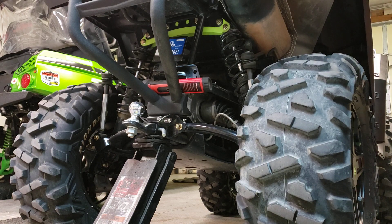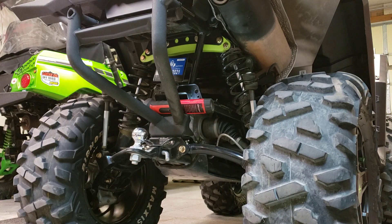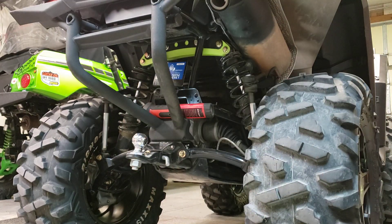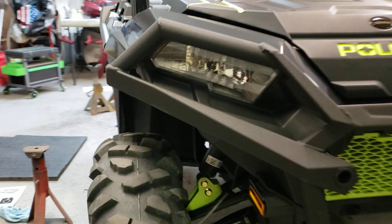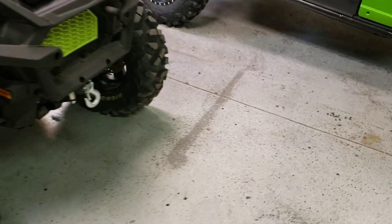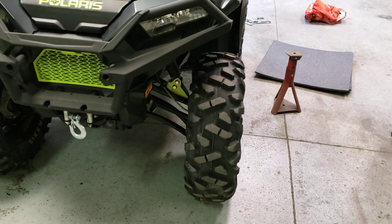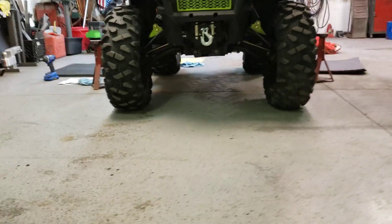So I've got to torque everything back down, but there we go — that's got it all installed now. It might be hard to tell. The front shocks I turned all the way back down. There are your front shock brackets — they're super easy to install. You don't got to move the brake line, you don't have to do anything. Unbolt it, put the two new bolts in with a spacer, and on the top shock right in there goes a washer, then you just tighten them down. You put the bike back on the ground and tighten them after it's on the ground — leave them snug but not super tight, put it back down on the ground and you'll be good to go.